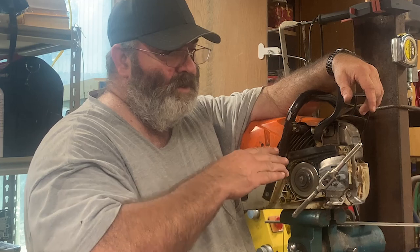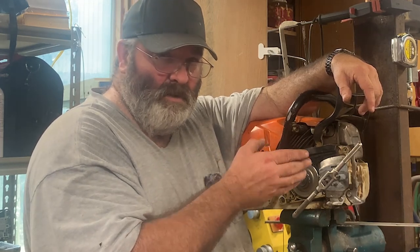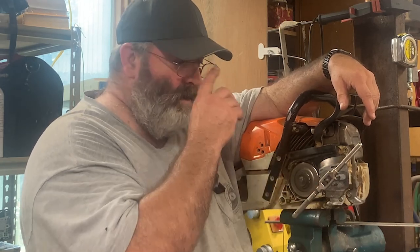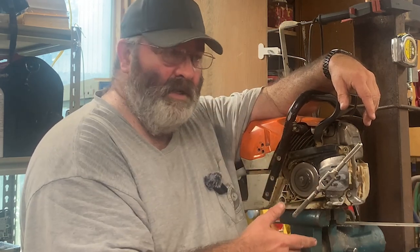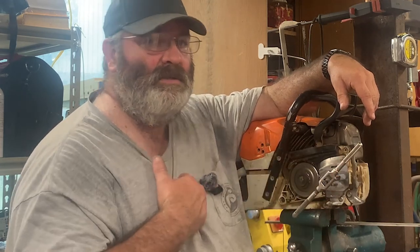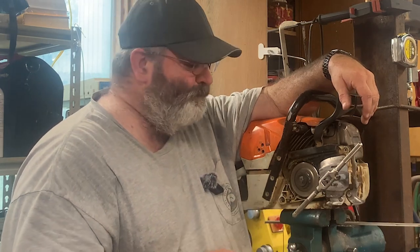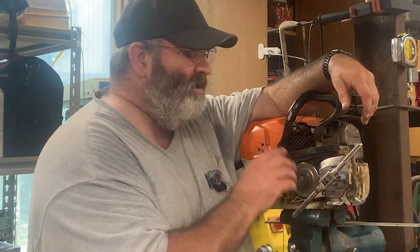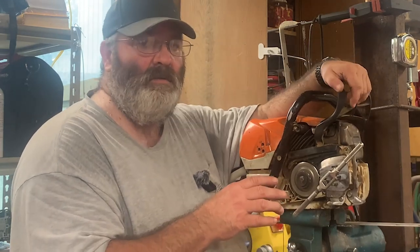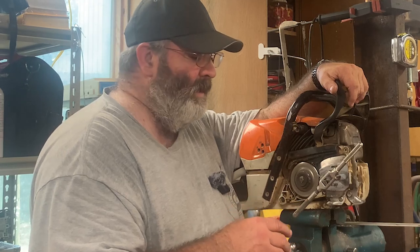And so you're getting into the bind where you're coming up against that hard, the more meat in the hole at an angle. And so you're having to cut threads through it. So you'll have deeper threads on one side and lighter threads on the other side. You still have threads unless you really get off, and I don't think you can tap it in there. But when you do get to that, especially when you're dealing with small taps, because you'll break them real easy, especially in steel and stuff like that.